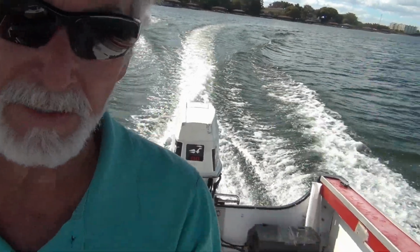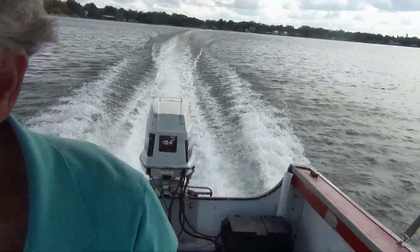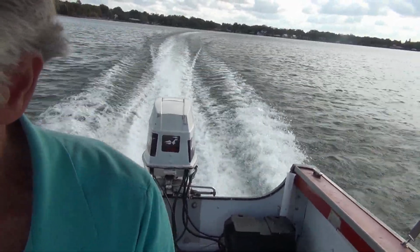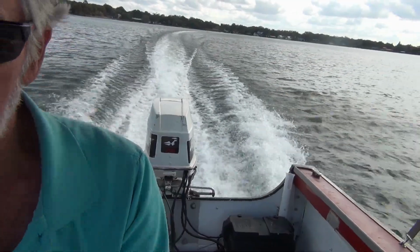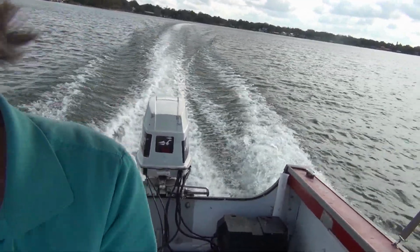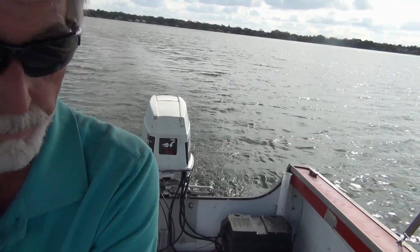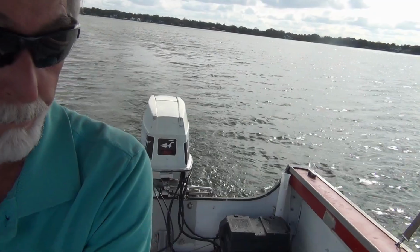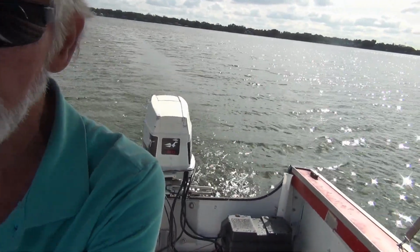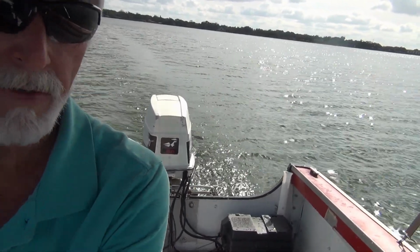Gets up on a plane and no, never a problem. 32 miles an hour, that old beat up prop. The reason I wanted to do this as an experiment was to see if that 19 pitch was going to be faster than the 17.